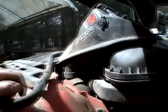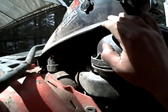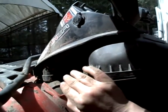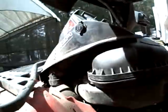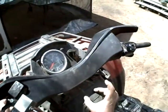Here's the breather box, and you can see this is the pipe work I've done underneath the cowl for the instrument cluster pod as some people call it. I got that part of the idea from a few different sites. I've got inch and a half pipe on the intake for this and two-inch on the CVT intake.